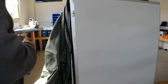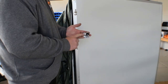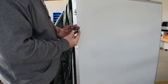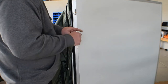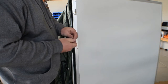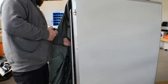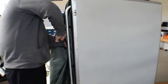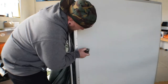All right. So next, you want to grab your ladder mounting hardware, which is the bracket, bolts, and ladder bolt. First, you want to just remove all the hardware from the two that go through the floor. Place the washers on the bolts. And then through the bottom of the floor, at the front edge, you'll see there's two holes here, two holes here.